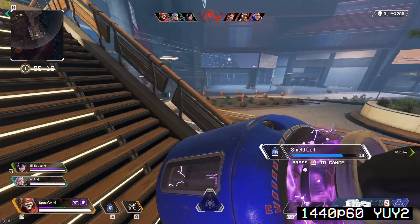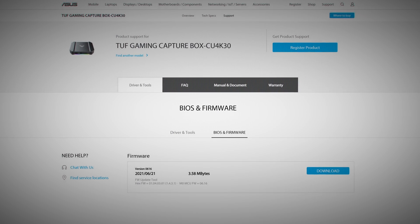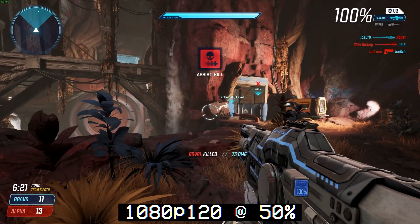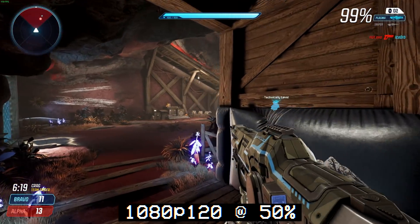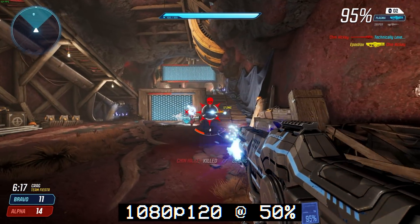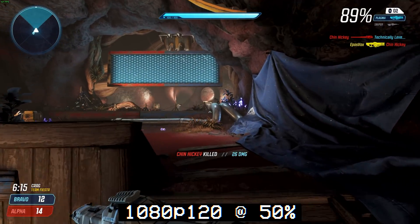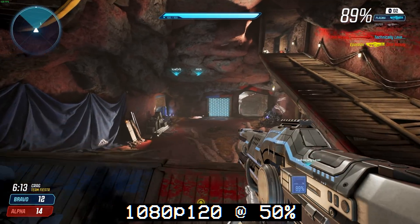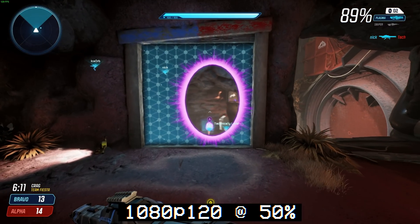To get a smooth 120fps from this card at 1080p, you'll probably need the firmware update available on ASUS' website. The 120fps mode is a key feature here, on top of 1440p support. There is basically only one other affordable capture card that can do 1440p 144Hz pass-through, 1440p 60 capture, and 1080p 120 capture over USB — the AVerMedia Live Gamer Ultra, which came out four years ago. So it's great to see more options, and the audio connections give the CU4K30 an advantage over the Live Gamer Ultra anyway.